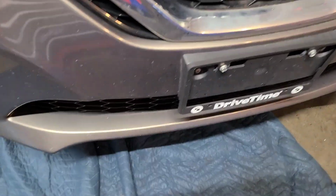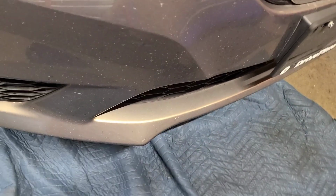See the 4-cylinder engine up here. We're gonna go straight down, and you're gonna need an oil wrench. Let me get that. It's a smaller filter, but you go straight down under the car, and you want to make sure you can get your oil filter free. Your oil filter is right here. That guy right there next to my light.